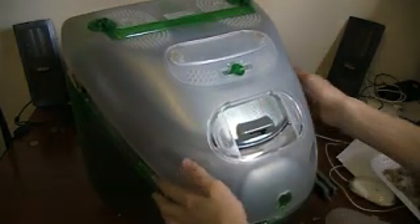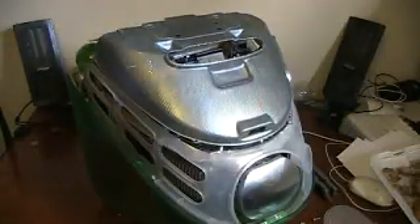The first thing you do is you take off your bottom case. It's held on by two screws right here. And then you have to take off this little cover that covers your external monitor port — there are two screws that go right here. So then you gently take that off and just set it aside.